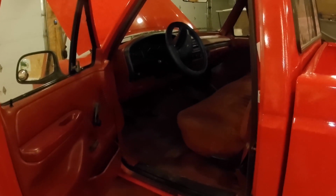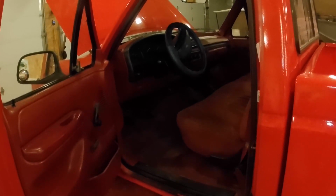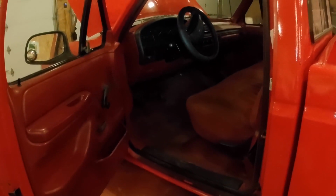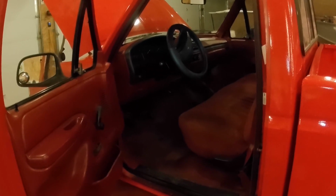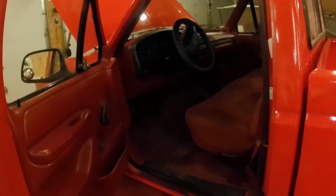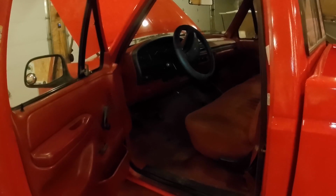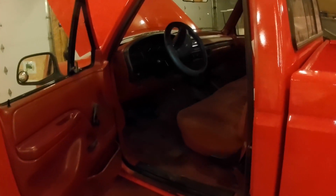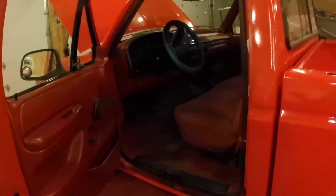And when you first turn it on, those first 3 digits that you count, it's going to do it twice. Those are the active codes. So like this one had one code. I think it was 144 or 114. So anyhow, I counted those flashes. You know, 1, and then blink, blink, blink, blink, 4, blink, blink, blink, blink, 4. Okay, then it did 1, blink, blink, blink, blink, 4, blink, blink, blink, blink, 4. Okay, 144, then blink one time, then there's a pause, then it goes into old codes. So I wasn't real worried about the old codes, but that 144 or 114, I can't remember.